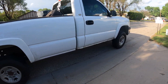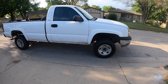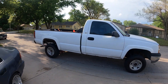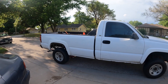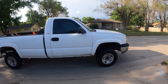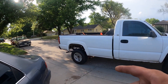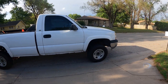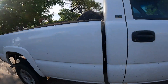The main purpose of today's video is the work truck. I don't know if I've ever done a video on this or not, but it's my work truck — 2003 Silverado 2500, has a 6.0 in it. I just put a leveling kit on it: three-inch front leveling kit and two-inch rear. I'm about to put my wheels back on.